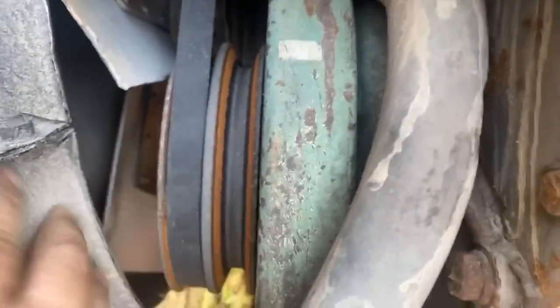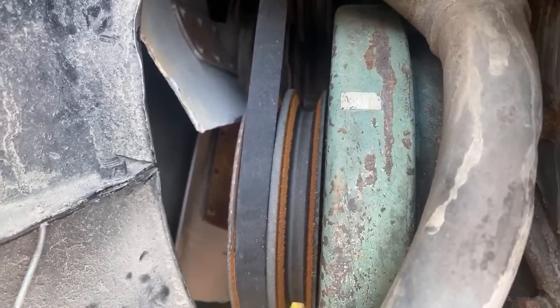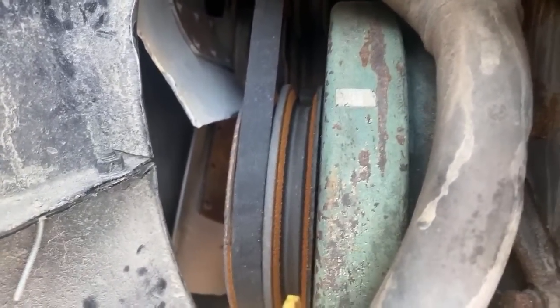okay, so right there on the pulley, see that big break out of it? So that's the V groove there. I can't really quite get the focus back there. So the V groove on the belt for the pulley drive is busted. The whole side of it is missing on one side. So that allows that belt to ride deeper in the groove and wear more. So the two belts wear unevenly, and then you've got one loose, one tight.